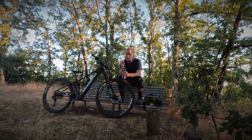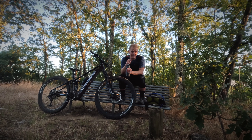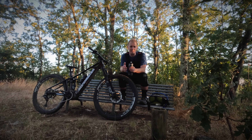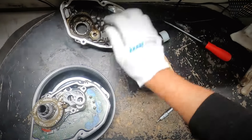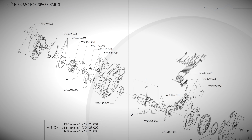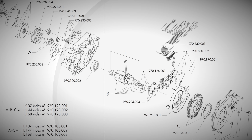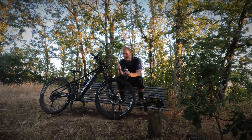I've heard comments saying you can update them online via phone, but I just had a Shimano EP8 - not the 801 - and I updated it. It failed the update and the motor is now bricked: doesn't work, nothing, dead, doesn't turn on. I have to take it to a Shimano dealer to get it resurrected. Bosch is a fairly repairable motor once you get past the guarantee period. Shimano - not really, very difficult to repair. The most repairable motor out there is the Polini EP3 MX: all parts are available, you can fix it at home, and it will guarantee its lifespan for at least 10 years. I'd like to know how repairable the ZF and DJI motors are.